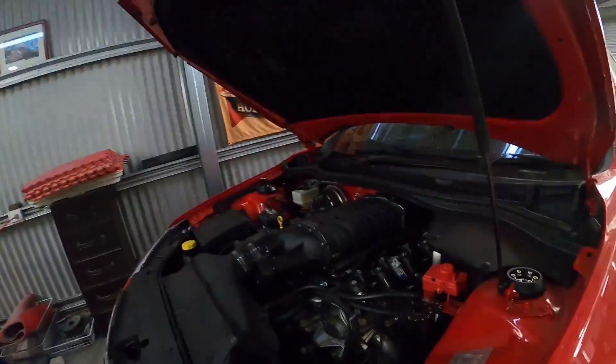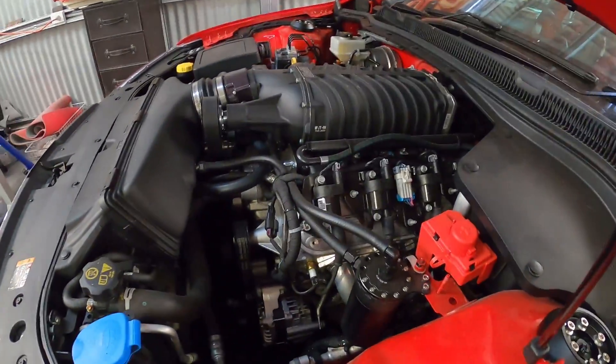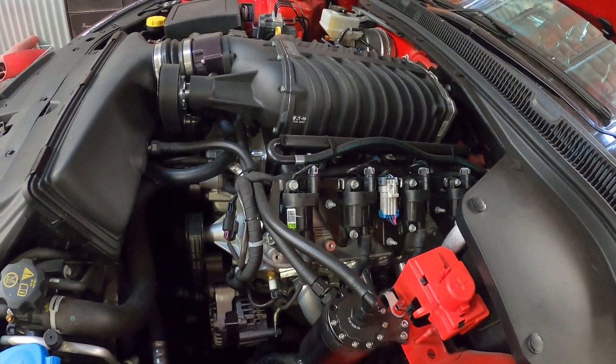How do you know you're actually going to need to do this? There are three telltale signs. The first one — and we're going to use Clooney as the test bed — is that at low RPM, probably less than 2000 RPM, on the passenger side you hear all this rattling. It wasn't like a death rattle, but it definitely went with the harmonics of the car and sounded like either there was an engine mount slightly loose, but at higher RPM the rattle would go away. I don't know whether the springs had a little reverberation in them, but this rattle at low RPM is what a lot of other people say too.